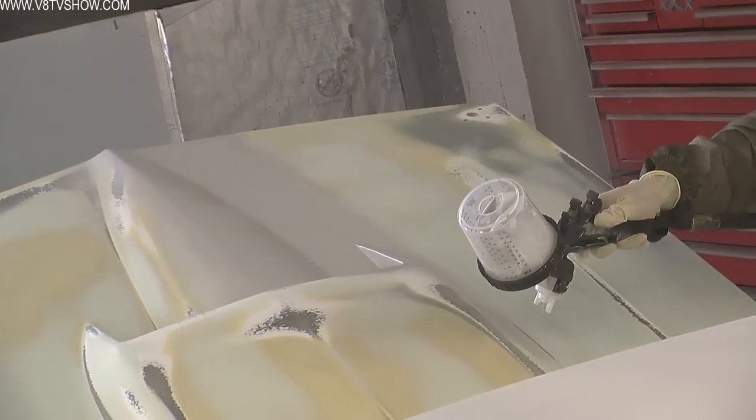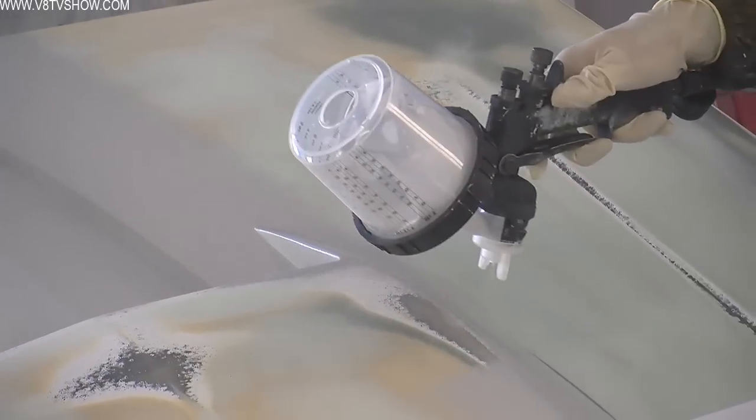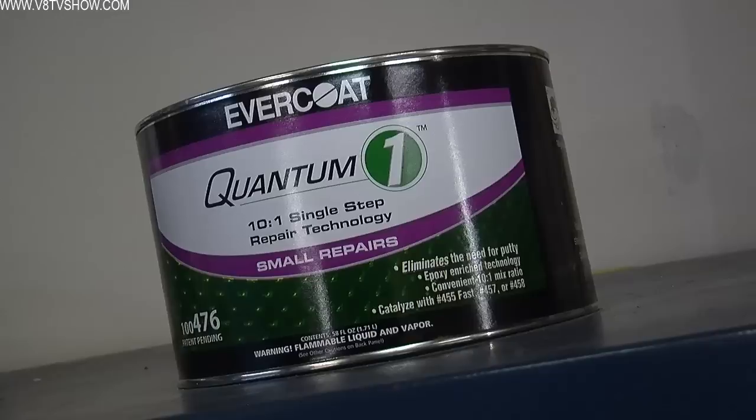The worst case scenario is you put a big heavy coat of primer on, the top surface starts to dry, and then you go back and block sand it and everything looks great — but maybe a month later, maybe a year later, the solvents evaporate out leaving all of those sanding scratches to return. You can see this at a car show or on a used car lot: areas under the paint where you see sanding scratches. A lot of times those scratches were not there when that repair was made — it took a while for those solvents to leech out of the primer and paint and then everything sucked down around it.